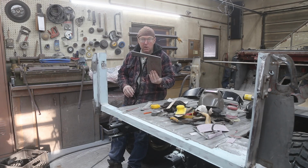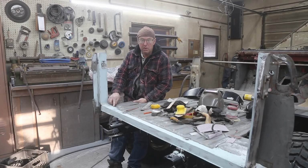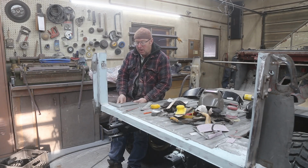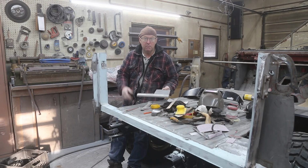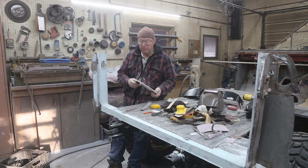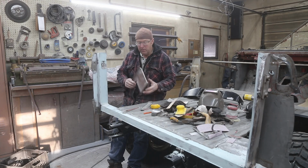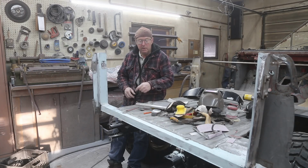Now, when I weld this on, of course, there's a good chance that it may blister up a little bit of the filler. Well, that's easy. Just touch it with a grinder, a little bit more filler, it's done. So I would rather do the body work when it's easily accessible, and then just repair the odd spot where the welder may have blistered up the filler. I've done that in the past, and it's worked just fine and dandy. So anyway, we'll continue on. We've got a little bit more sanding to do, then I'm going to modify this panel.